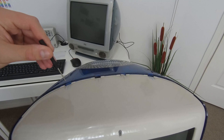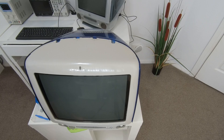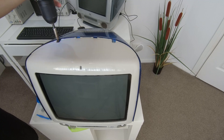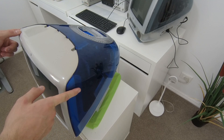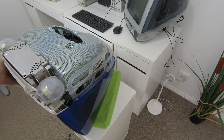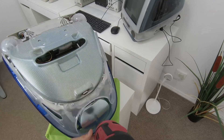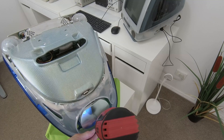To remove the top plastic, you will find two plastic clips on the top of the case. Once the plastic covers are off, simply undo the top two screws. Before you can remove this blue cover, there are also a couple of screws at the bottom of the computer, and four screws located around the back of the computer on the blue plastic.